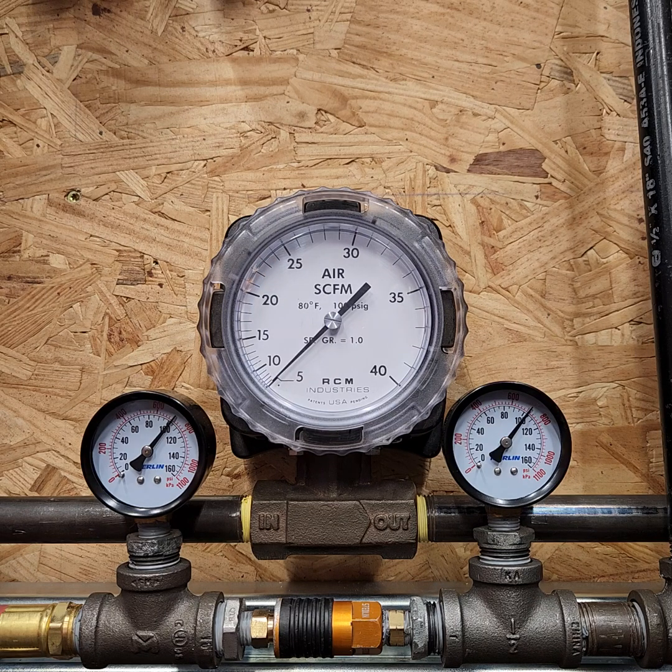But I wanted to take a little intermission from pressure drop testing to just run a couple air tools on this rig and see what the actual instantaneous flow demand is for some pretty conventional air tools. I think maybe people are discouraged when they buy a die grinder or something that's rated at 4 CFM and they get it home and their 10 CFM compressor can't keep up. And obviously the numbers are adjusted a little bit for working factors. So we're going to see just kind of what the magnitude is of that.